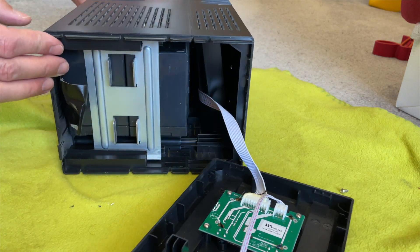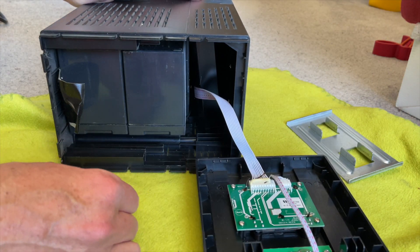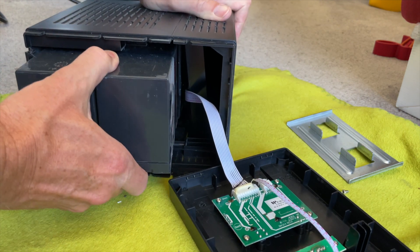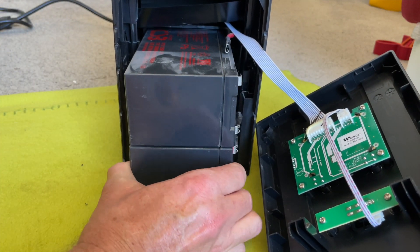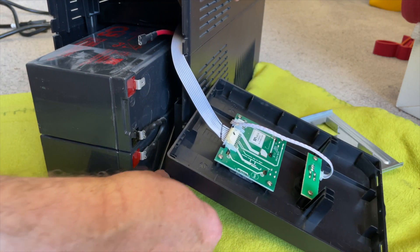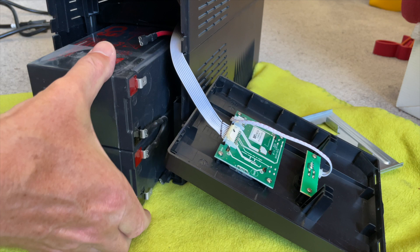Now slide off the metal bracket that keeps the two batteries in place and pull on a piece of duct tape attached to one of the batteries in order to slide them out in one piece. It takes some finger strength and they'll squeak a little. Also note that the cables attached to the batteries might come off — the red cable, for example. You can only get the batteries about halfway out before the terminal cables will prevent further movement, and you need to get the cables off the terminals to continue sliding the batteries out. As you can see, the red cable on top already came off when I pulled on the battery.